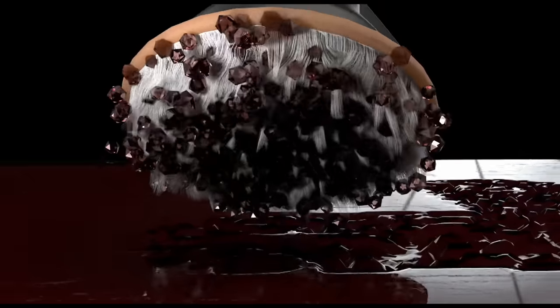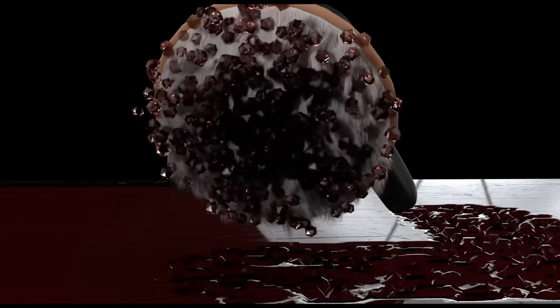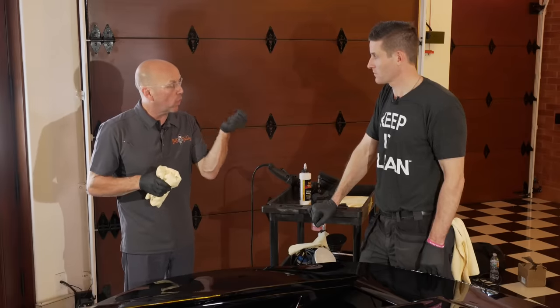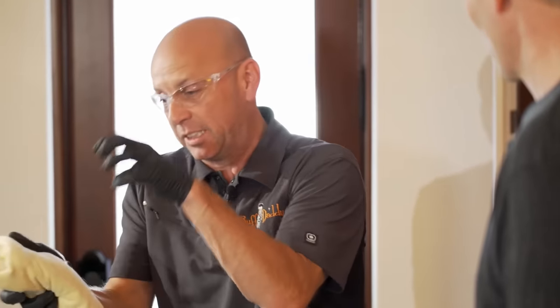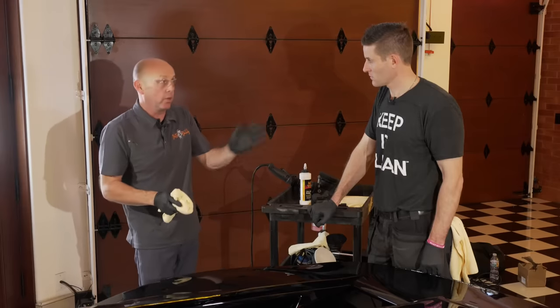Constantly. It's like, wow, you have to avoid contaminating the pad with the paint residue. You've got to control that residue. And if you do too many passes, especially with that minuscule quantity of liquid, it doesn't have the ability to coat that pad and help it resist things attaching to it, right? So that's why I say look for oiliness. If you see oiliness, even if you don't see an abundance of white liquid, you don't want to see that.